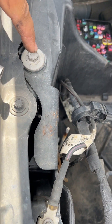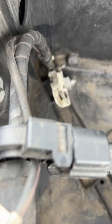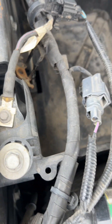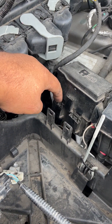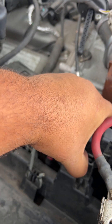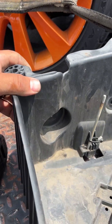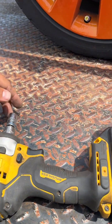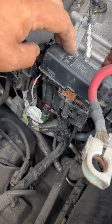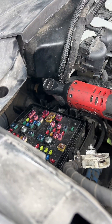We got the battery out. Now we're going to pull these battery tray bolts out. There's one on the side right there, and there's probably one down there too. You got to push the tabs on these. I got it out. There is definitely another bolt — one right there, one there. It's a 13 millimeter. You pop these little tabs off of here and one off of there. Now I've got clear access to it. It's pretty simple. You just got the one 10 millimeter down there.